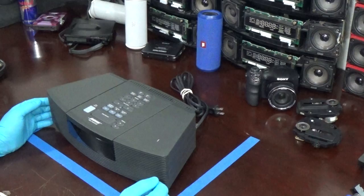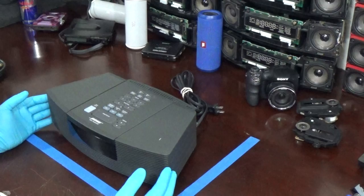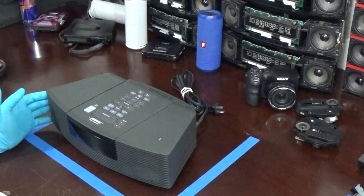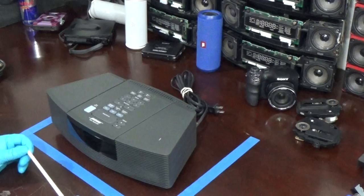Well, this one did not have that. All you really had to do is just clean the lens or make sure that you don't get the lens dirty. You can get away with using one of the units for 6 to 10 years with barely cleaning the lens once or twice, if even that. In other areas, if there's a lot of moisture or oil next to the oven you're cooking and you have this out there, the lens will get dirtier much quicker than that. Okay, so that is the main reason why they redesigned the unit. Okay. I'll talk more about the internals and things like that when we tear this unit apart.